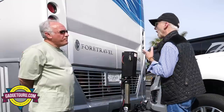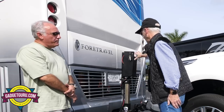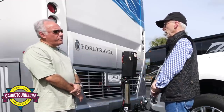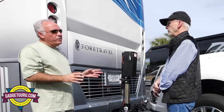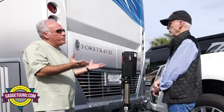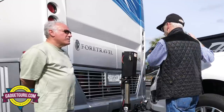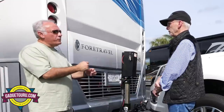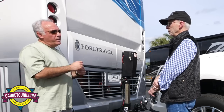The big question everybody's going to ask: how much? The electrical one is about $2,995 — call it $3,000 for an electrical. This is the hydraulic version, which can run off the bus's electrical system. The hydraulic adds $500, so we're talking $3,000 to $3,500. The parts for the car — that's all included, everything is included. The buyer will have to take it to somebody who can mount it, or some people can mount it themselves — there are four bolts. For someone who takes it to a machine shop, it should take a couple hours. If they have to do any welding, we're talking $200 to $500 depending on where you go. The bolts come with it — they're shear bolts and you have to put Loctite on the bolts.